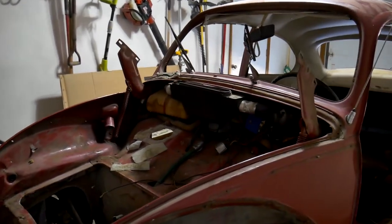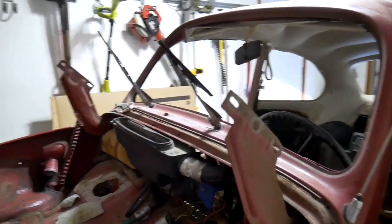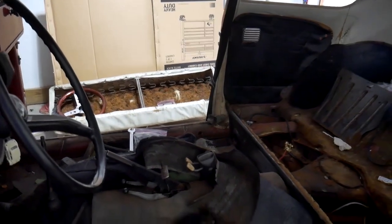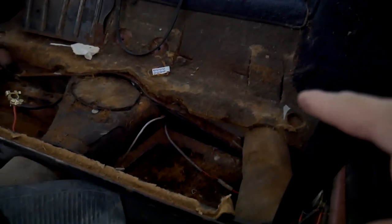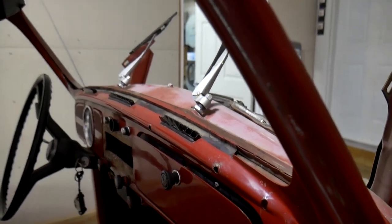It's Saturday morning and it's been pretty productive already. I've been able to get the windows out and I went over getting out the gas tank — I need to get it out from under my feet. I pulled out all the windows and really all I'm working on now is preparing this body to get pulled off the pan. I've located my mounting bolts on the inside, and I started to pull up the carpet — just the sides where it connects to the pan. I did find some evidence of some more serious rust.